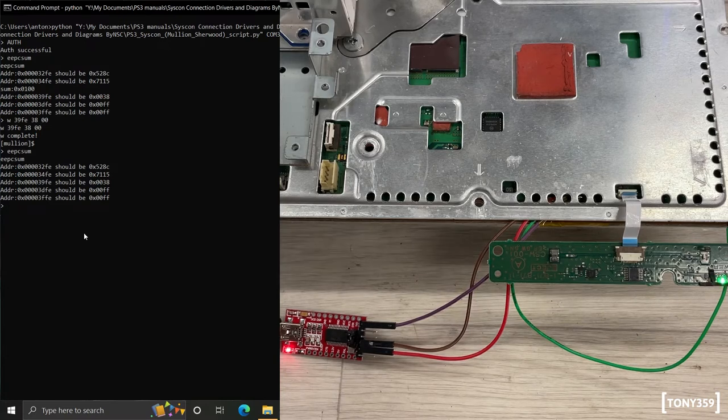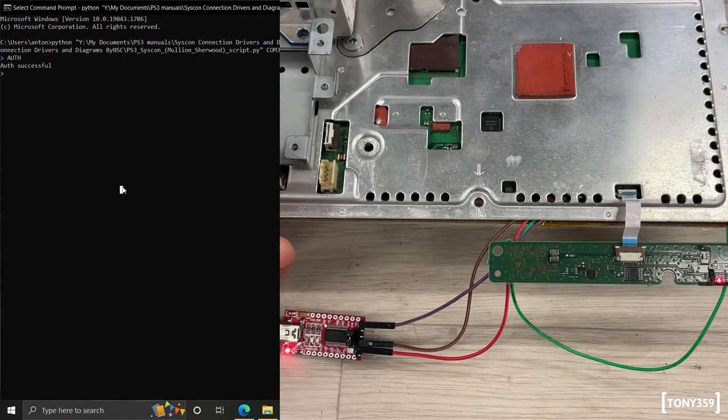We should be in internal mode now. Testing with the 'bcount' command - it works! This PlayStation has been turned on 2,006 times, shut down 17,067 times, and been on for 241 days - so it's been well used. I've experimented a bit with the Syscon behavior and found something interesting: the thermal sensors are not reporting any temperatures until the PlayStation tries to power up. So I can't check the temperature while the system is idle in standby, because it doesn't work like that.